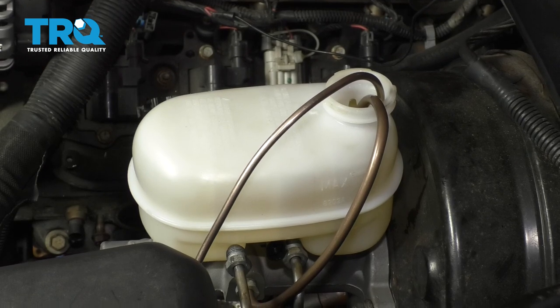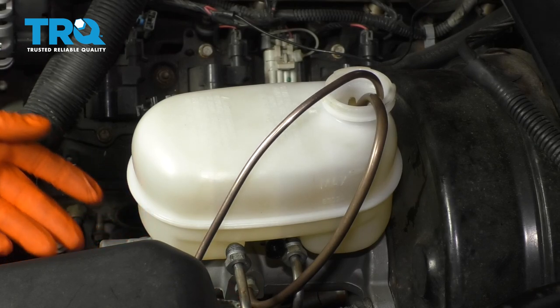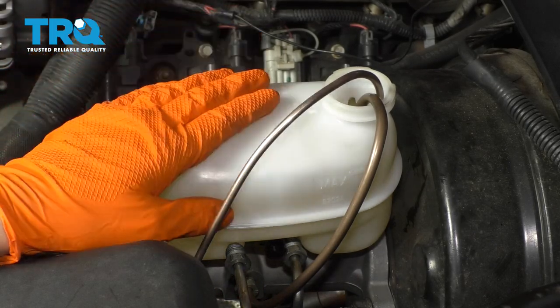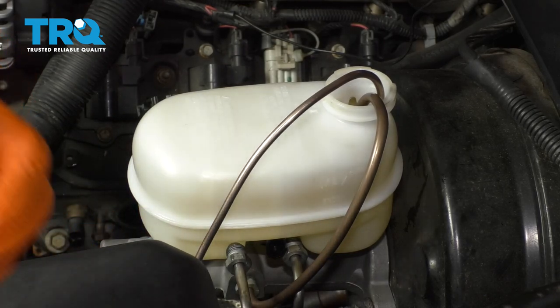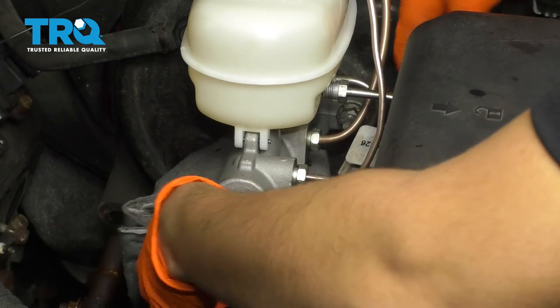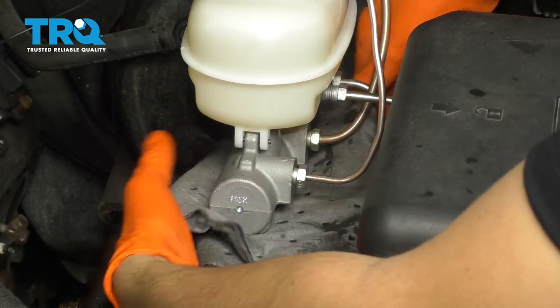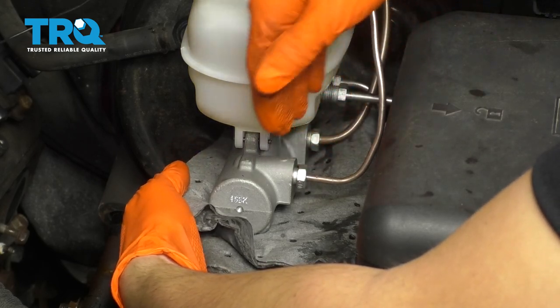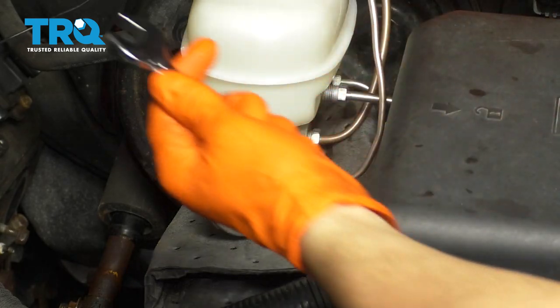I'm going to get out and double check my brake fluid level. As you can see, it has gone down quite a bit. I have no leaks, which is good. I'm going to do it a few more times to make sure that there's no more air in these lines or in the plunger area, and then I'm going to continue with reconnecting the lines. Before I remove my bleeder lines, I'm going to put another pad down. I'm going to lose quite a bit of fluid because the lines are full, so as soon as I break them free, the fluid is just going to come pouring out. But the good news is it's not going to be more than what's already in the lines.